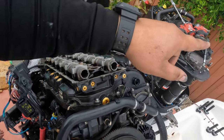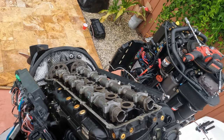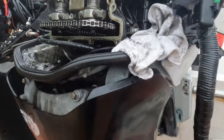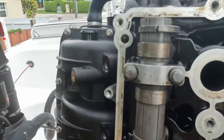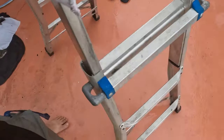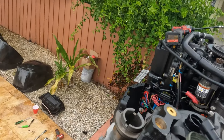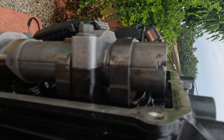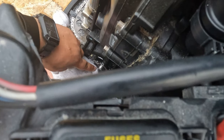I'm going to take that apart, put it back into time, and then run the motor to show you. Our port motor is doing the exact same thing, so I'll show how both the port and starboard are running the same way. Here is the tensioner I was telling you about. If I get up here, you can see that these notches now line up — see those? Right here is your tensioner, and once those line up, that's it.